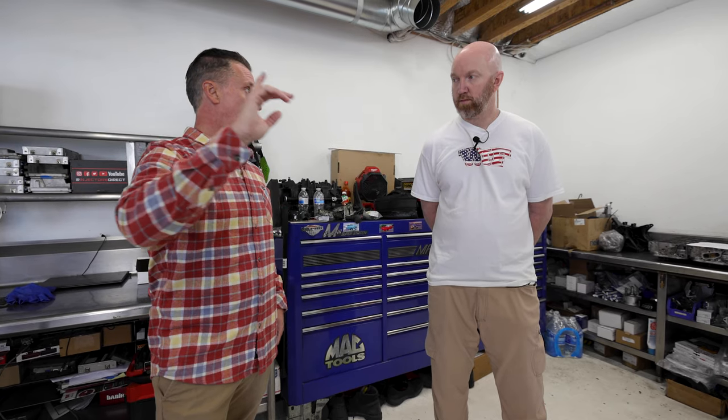Gotcha. Or a turbo is questionable. If you have a lazy turbo, because we do have a lot of new components going into these engines, what happens if the manufacturer doesn't manufacture something correctly, or there's a bearing going out or something like that, we're going to see it when it's on the dyno. We put a heavy load on it and make sure that turbo's good and it's making the fuel flow rates at load. A lot easier to fix it here than fixing it in a truck.